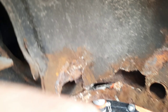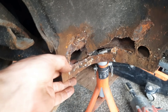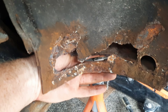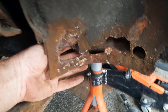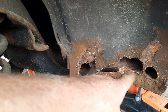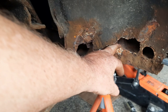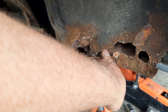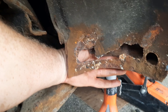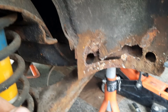Now it doesn't look too bad but the inside section here, the bottom of it, doesn't exist. And the back piece of it there has gone. It's fairly substantial and it's only a curve with a flat bottom on so it's easy enough to make. It's just awkward because of the access for the suspension. So cut all this off and make a new section — cut it all out, all the rot out. Make a new section behind and weld it in onto the inside of this and then wherever I can get to on the opposite so it's structurally strong. Then just tack it where I can reach on the back — the actual strength will be on the inside. Then put a new plate all the way right round, fill it with wax and then we're good.